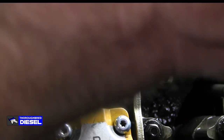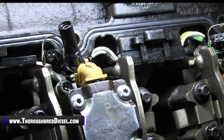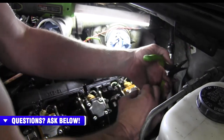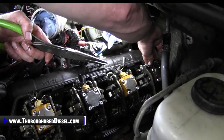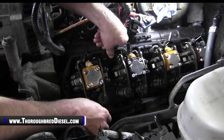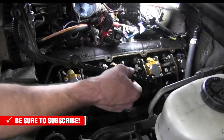You can flip it up out of the way. So now I'm going to go through and do the other glow plugs. Flip that up out of the way. Your number eight cylinder is a little bit harder to get to. Got it — pops right out. So now we've got all the wiring harness disengaged there. Removing it from the truck is just as simple as picking it up, so be aware of where all your connectors are and lift it right out.